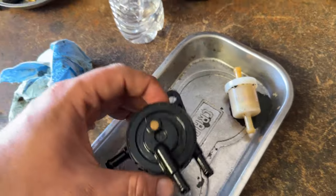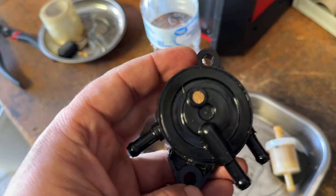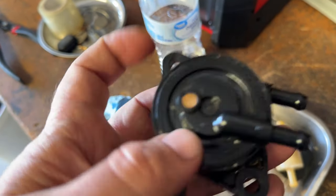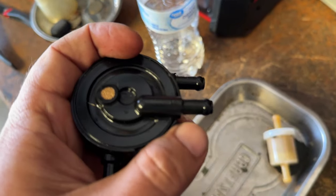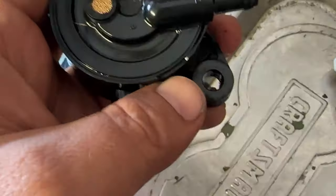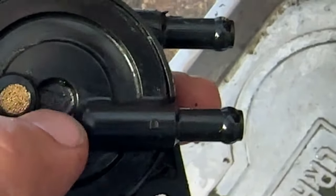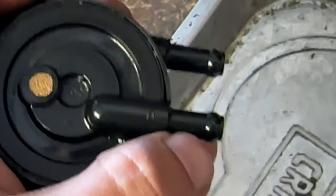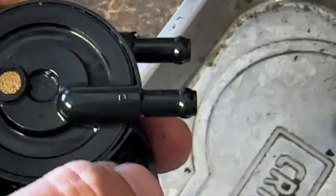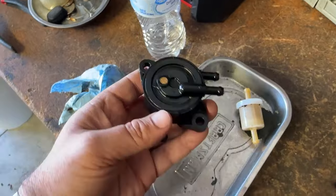I'm here looking over this fuel pump, and sure enough, every single one of these that I've seen that's failed — this type of internal diaphragm fuel pump — they always split, and that's where they leak from. You can see right where this hose goes in, the thing is just split. I think the oil from the internal crankcase pressure was being pushed out here and then down into here as well. That's just one of these typical failure points on these.